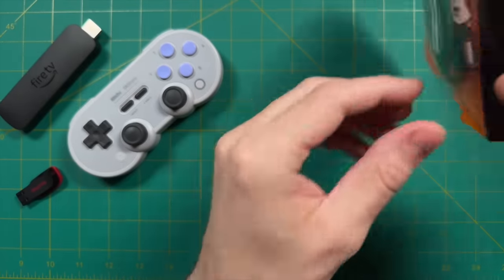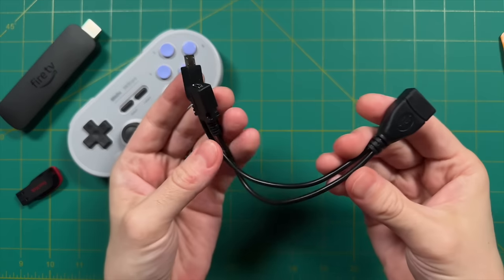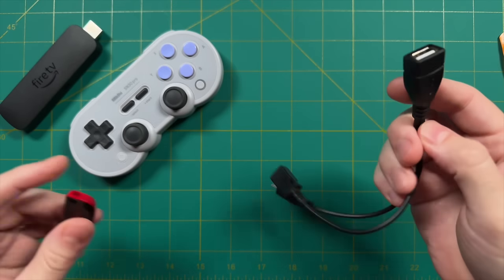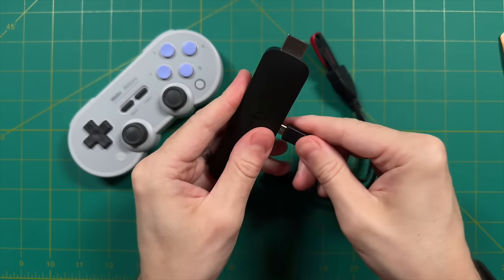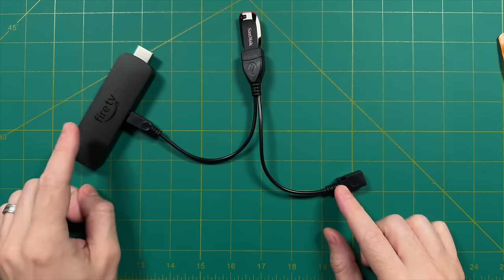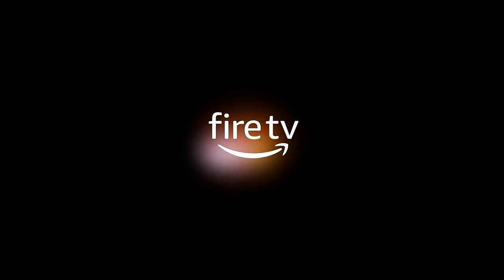Other than the USB drive, we need a way to connect it to the Fire TV. Since it only has one USB plug on the side, we need a USB port adapter — basically a USB splitter that's around $6 or $7. We'll plug the USB drive into the USB-A port, then plug the micro USB side into the Fire Stick. From there, we'll connect the power plug to that final adapter. This way, we supply power to both the flash drive and the Fire TV and allow them to communicate with one another. That's about it when it comes to hardware setup.